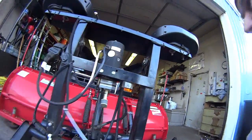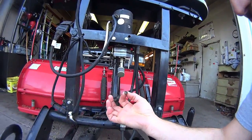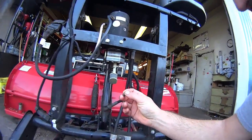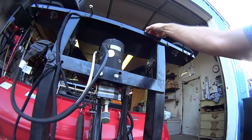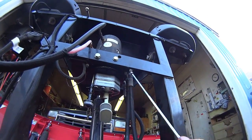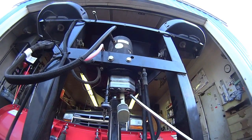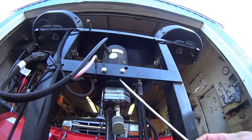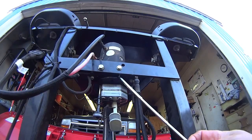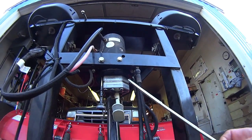Don't be afraid to take this tank off because what you have is four little screws that hold the tank in place — one is here, one's up here, here, and two on the other side. What you have is you actually have an O-ring that runs around right here. That's what actually seals your tank.